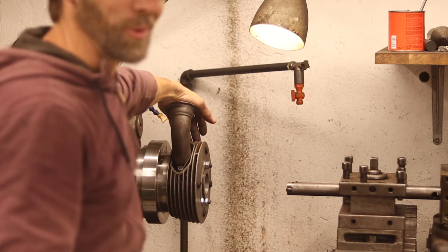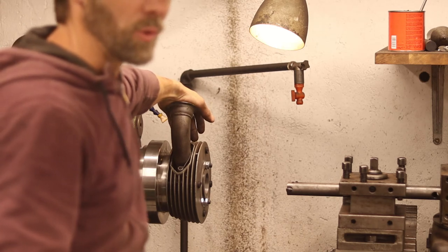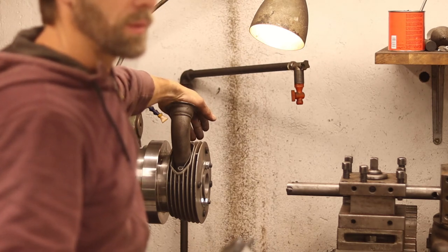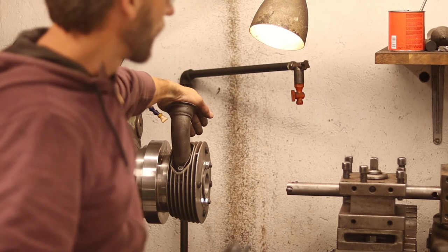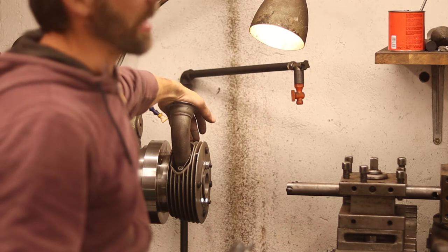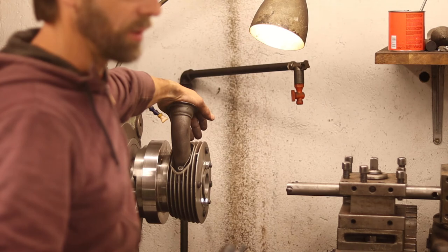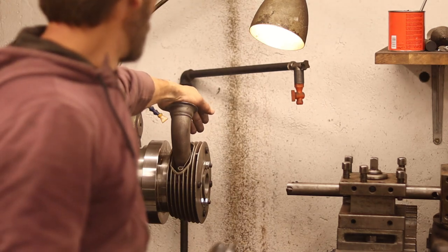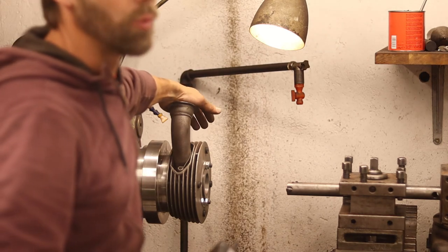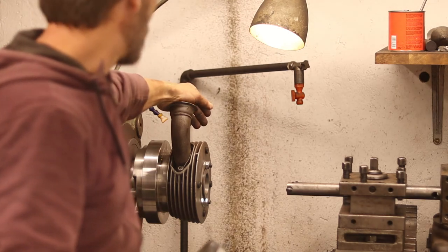Maybe I'm gonna have to go back and look at the video. But as I recall it, we were two hundredths over. No, sorry, two hundredths under. And I decided to take another two hundredths, and now I'm five hundredths over the measurement we were shooting for. So it's not a problem. I am going to have to just order a piston in the right size. It's not a big problem,